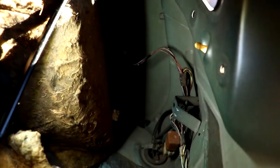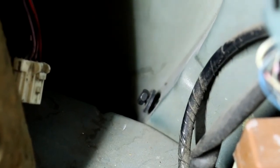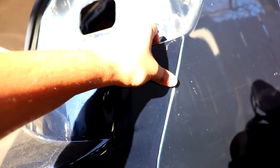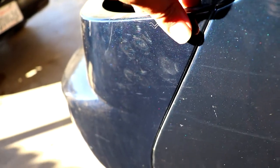I'm loosening the bumper on the G35. There's like 3 bolts. So you can see that black bolt right there. There's 3 of those. One right there, one like right here, one like right there, kind of, and in between the wire and that plastic thing. Gotta remove those to loosen up the bumper so you can tuck in your wrap. See here? But yeah, right here. That's where I'm gonna tuck in the wrap, so I gotta loosen up the bumper here. So let's get to it, guys.